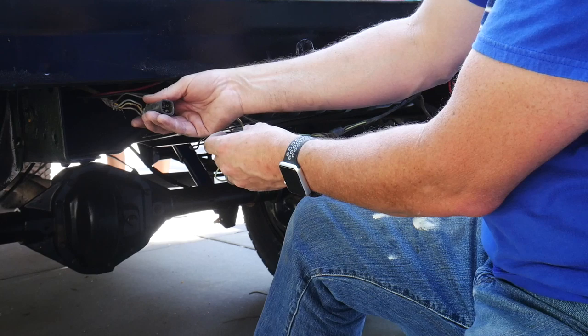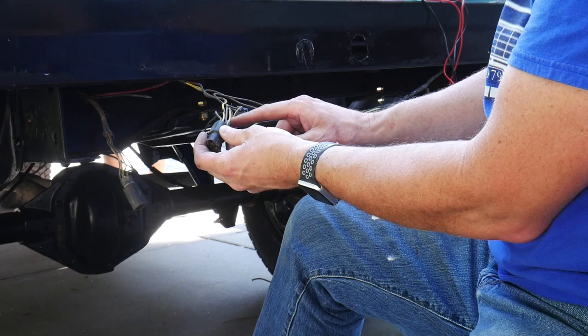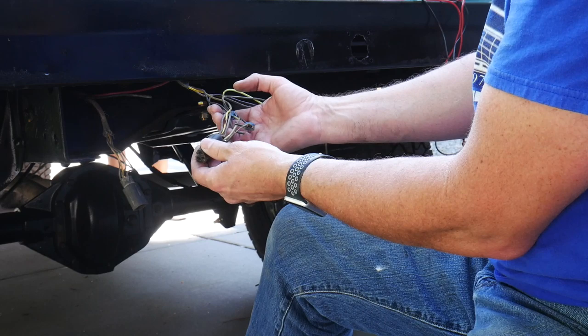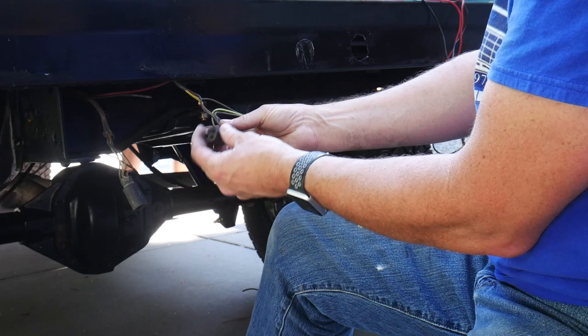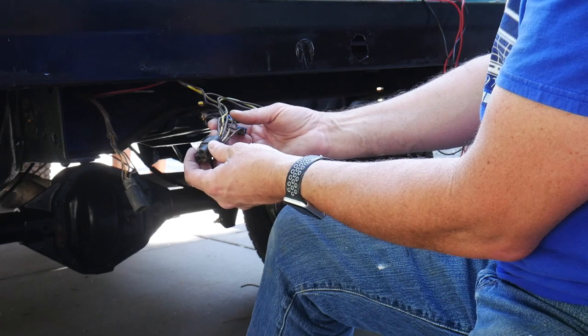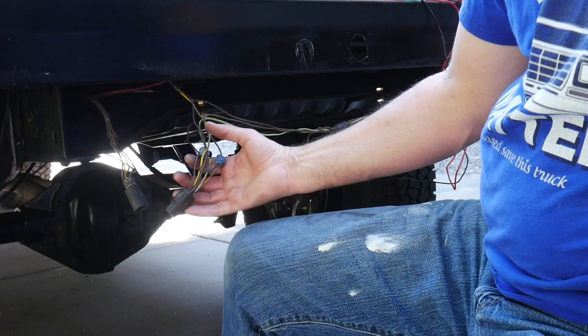So what I've decided to do — I found out which one is providing power and which one's the ground. I'm just going to cut these off so that I have a little bit of wire left that I can splice against. Then we're literally doing trial and error until we get this right. I'm going to have to have Tavish push on the brakes, turn the lights on and off, while I put a voltmeter on stuff and see which ones are passing power and which ones need power to turn the lights on and off. I've got to go to the store, get some stuff to splice with, some new electrical tape so I can clean it all back up when I'm done.